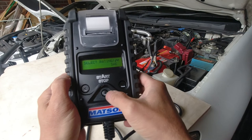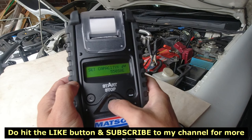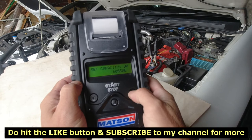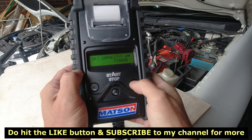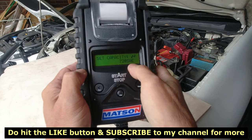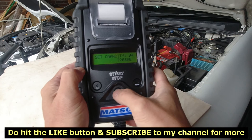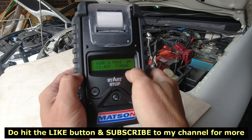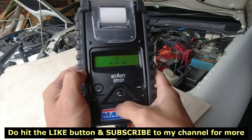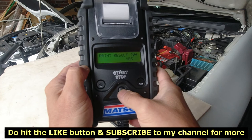and choose the SAE cold cranking amps capacity. In this case, this battery has 720 cold cranking amps. I'm going to select SAE, press forward to increase the rating. I now have the rating at 720 SAE, which means CCA. Press enter. It's begun the testing. Tells me the battery is 12.43 volts, 710 SAE cold cranking amps. The condition is good and pass. Press enter. Internal resistance 4.34 milliohms. I won't press print results because I've shown you earlier what the printout looks like.